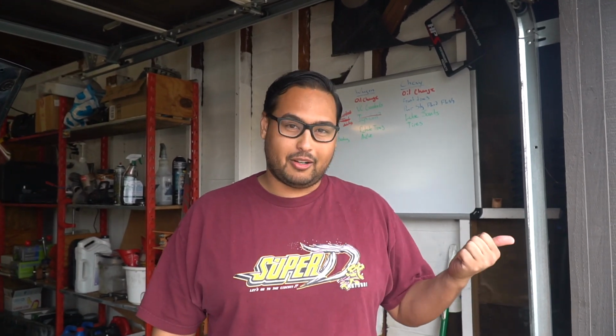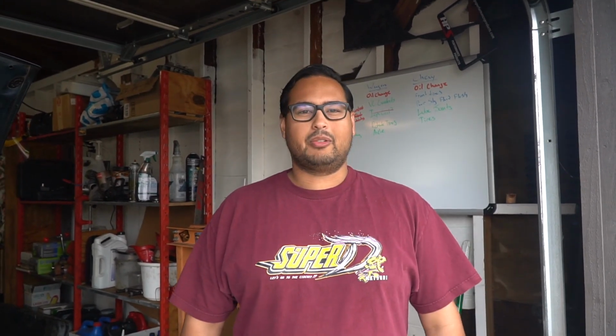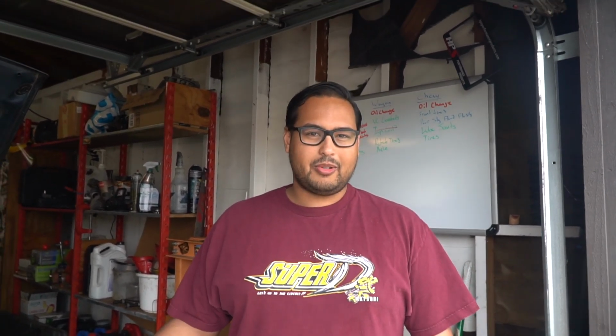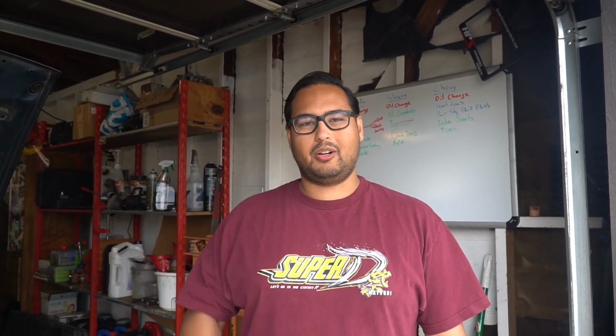But so we learned a lot on our first day. We learned these have more than enough power for us. Lots of pressure in the rear tires works. But we had two big issues, at least I did. So we found out that my $100 coilovers are garbage, and then we also found out that we have issues with the S13 arms. We lost a lot of caster, and it pushes the wheel back into the firewall, and there's a lot of rubbing.